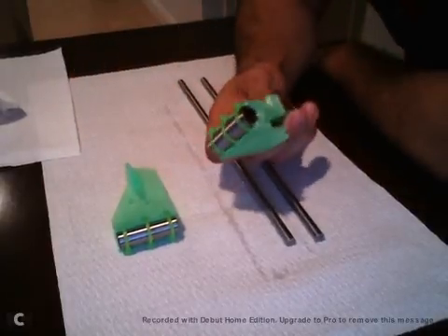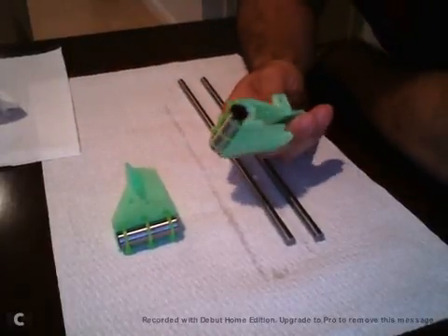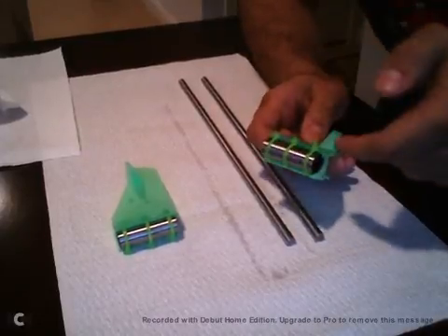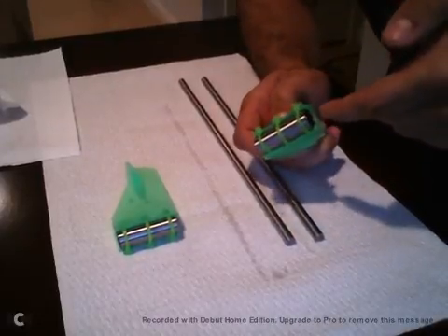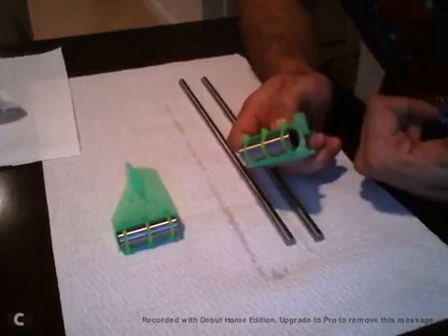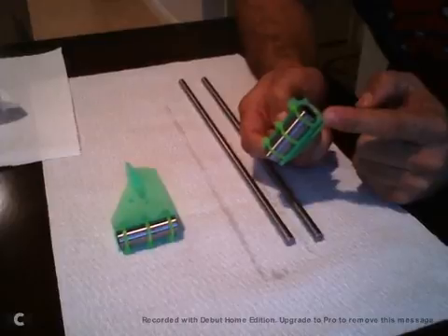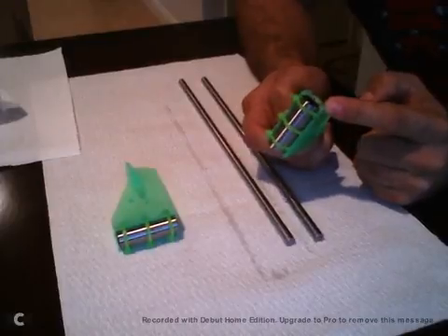The concept here is I'm going to put grease inside the bearing and then compress the grease in between two rods to force the grease in between the bearing surfaces, squeezing out the transport oil and any other contaminants, and packing the bearing full of grease.